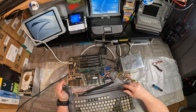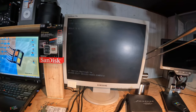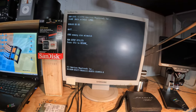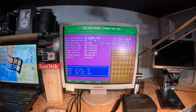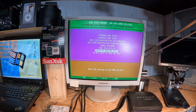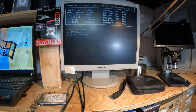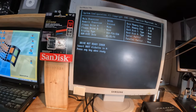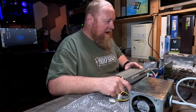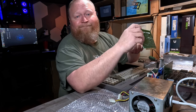RAM — let's try this again. Power on. 640K. Mismatch. F1. Standard CMOS — yes, escape, exit — right to CMOS and exit. Yes. Drive not ready, disk A — of course, there's no disk A. I guess probably the next thing to do, since it does at least post, would be to try and get it to actually boot. Who knows, it may just be as simple as popping a drive controller card on there and booting the thing up — watch it work. If that's the case, we'll assemble it. So fingers crossed — let's just throw caution to the wind and hook up all of it and see what it does.